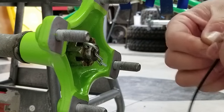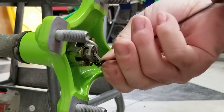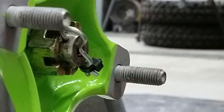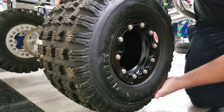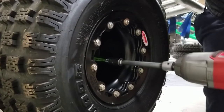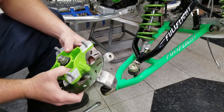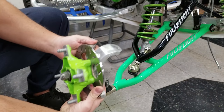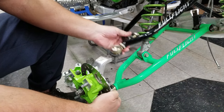I always put just a little bit of red Loctite on these. Then I'll throw a new zip tie on here - what this does is it just prevents your cotter pin from flying out, because they will fly off. Since we're changing the look of this quad pretty drastically, I thought it'd be cool to put the wheels from the 250R on here because this is really the color scheme I eventually plan to run on this Kawasaki. The moment has come - let's put these spindles on. You want to make sure these are oriented correctly.